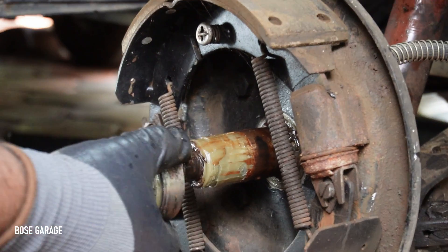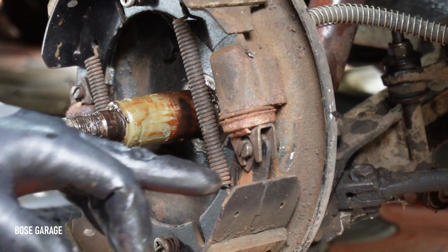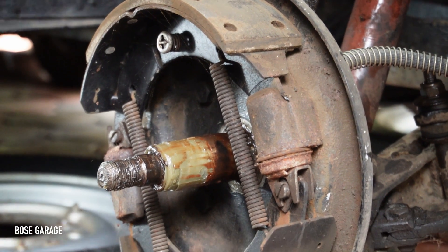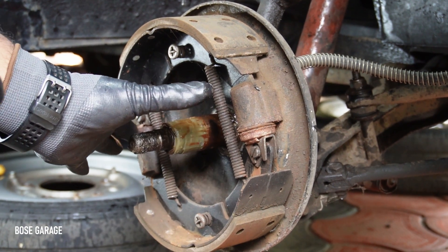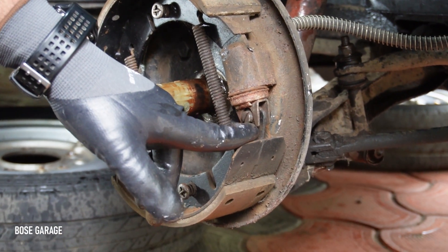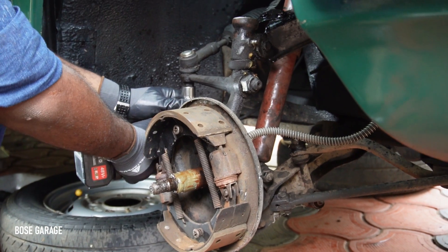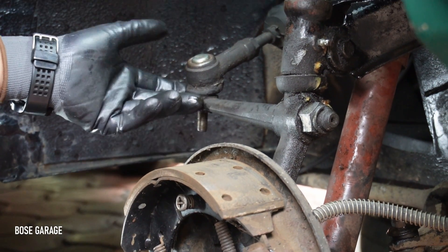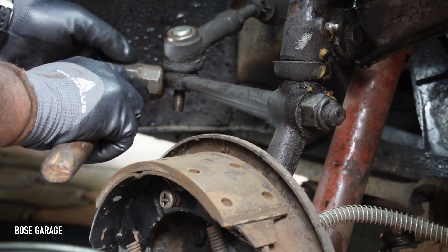There is a lot of rust inside as there was water ingress. After the suspension removal, we will have to replace the wheel cylinders and do a complete brake overhaul as well. There are two locking pins for the brake shoe, a spring, twin wheel cylinders up front, and the brake adjuster. Now let us remove the tie rod end. Normally there is a special tool for this, but without it the only option is to hammer carefully at the specific location.